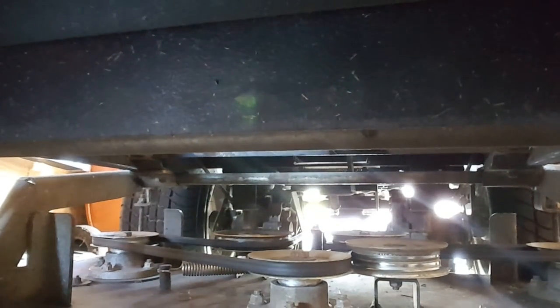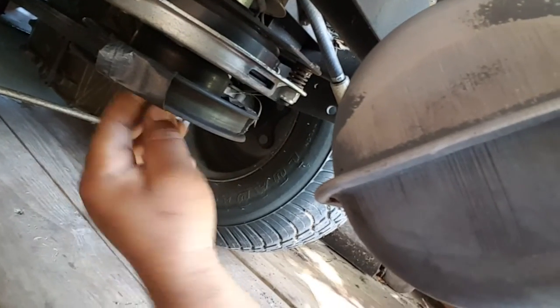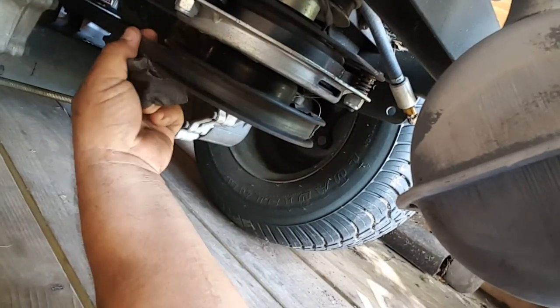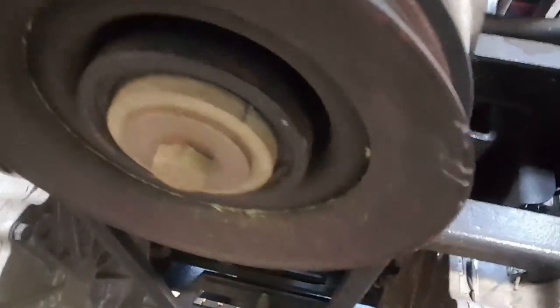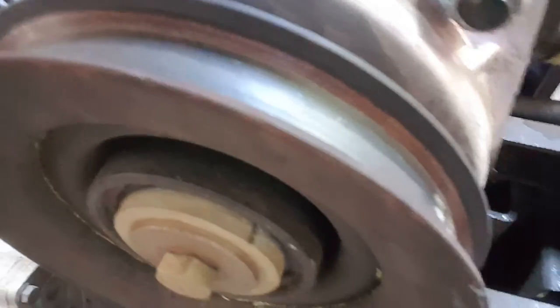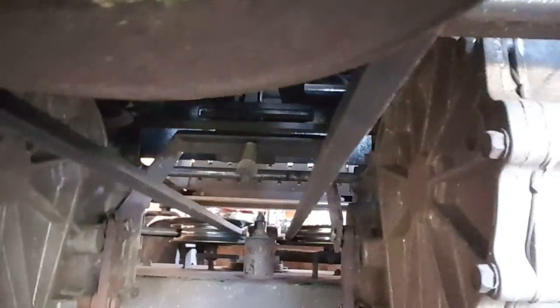Now I'm going to go take the tape off. When I turn on the mower I'm going to show you guys what it looks like. If I didn't put that tape, it would have been a back-and-forth struggle because that belt would go on and off. You can see the tape — I put just enough so the belt could stay on. Two pieces was enough. As you can see, the belt is on properly — it goes straight to all the spindles back to the engine.